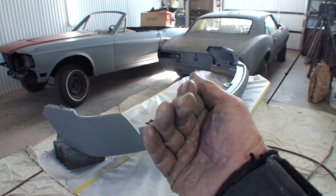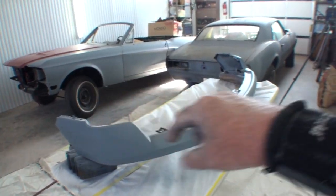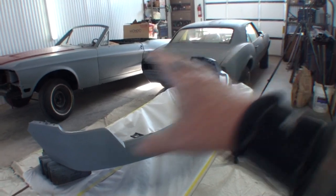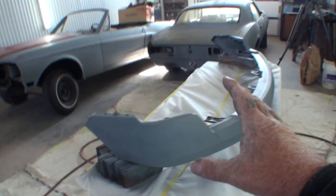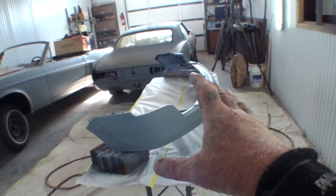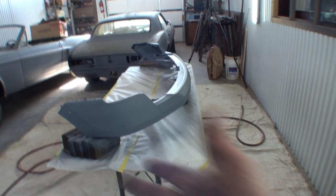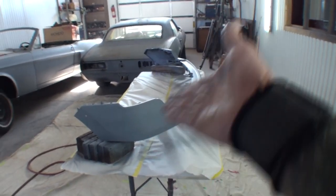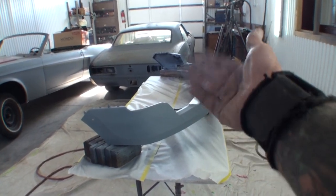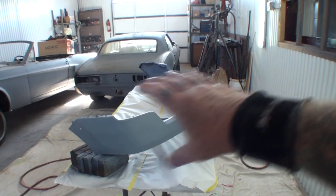This is Pete — my friend Pete, your friend Pete. I'm going to put two to three full wet coats of paint, I'll put two coats of clear on that, and hopefully it'll flow out — I won't have to buff it, I won't have to do anything. And when I come back, we'll go ahead and take a look at this bumper cover — a plastic part that I prepped from start to finish and showed you how to do that — and painted in full.